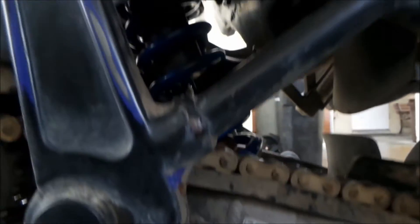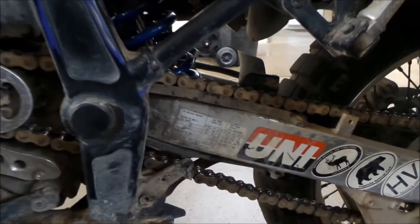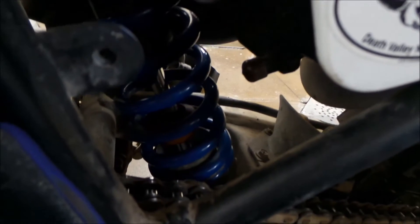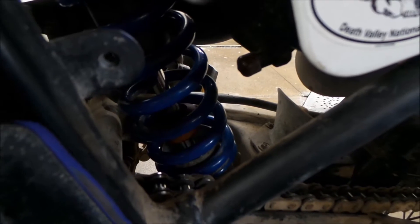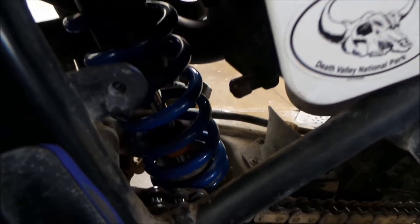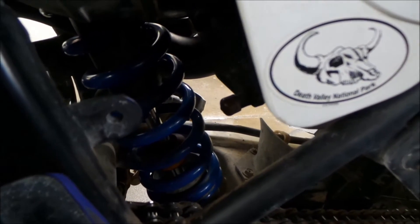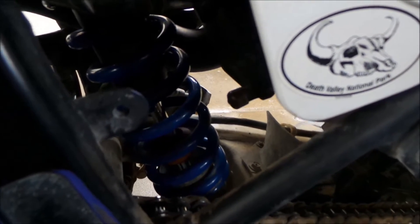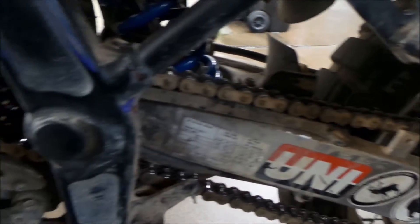You need to set your preload and your sag and all that. The problem I had is the collar — you actually have to disassemble the shock, at least the part where you can get the spring out, and then you need to flip the collar around. I've done some research on the internet and I hear people talk about this all the time, but no one has made a video or illustrated this. That's why I'm going ahead and making this video.